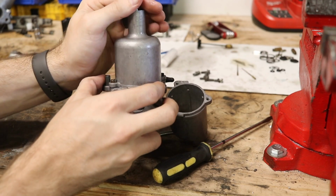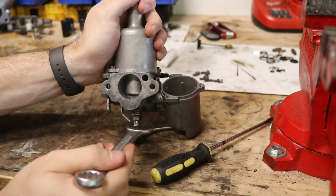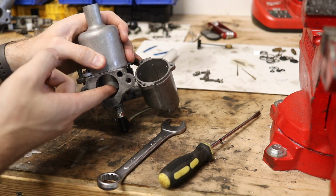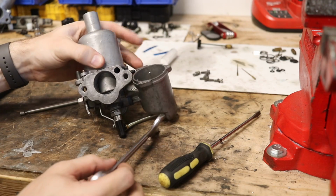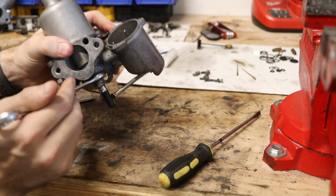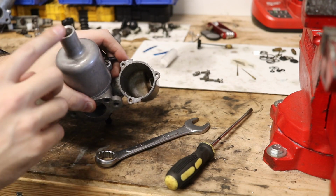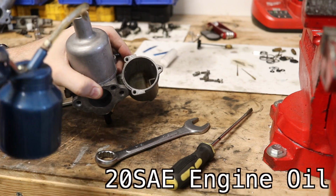And with that down and in place, we're gonna wanna lock the screw in. So at this point now, there should be no binding on your piston. As you can see, mine's moving freely here, and my nut is in fact all the way tight, so that's great. Now we're gonna add oil back to this right here, and the oil that you use is being listed on the screen right now.